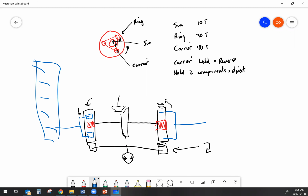And now I sped up one track and slowed down the other, just based on how fast and what direction I was turning the steering motor. That's how differential steering works. Are there more complex versions of this, in terms of the way the gears actually work? Sure there are. But when you really break it down, this is the idea of what we're doing when we talk about differential steering on track type tractors.